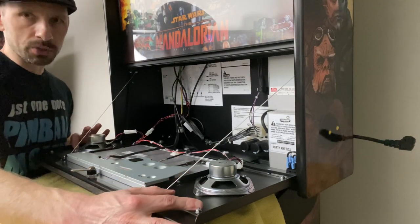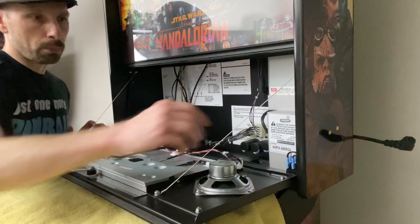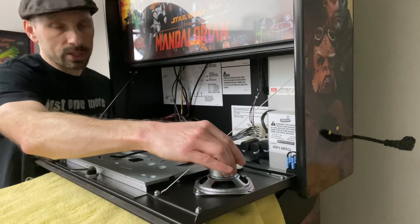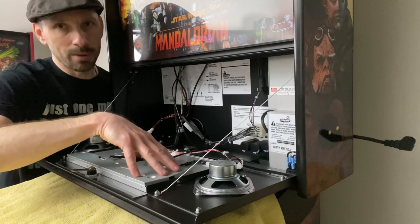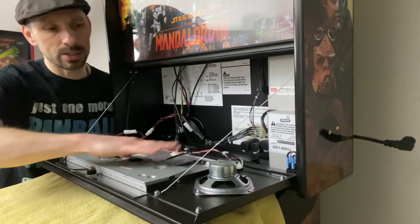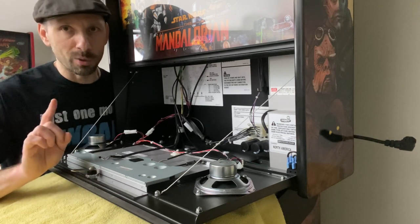This is what you'll see for the back box behind the grill, out of the box from Stern. You've got your speakers, four bolts that hold it in place, and two screws that attach to the LCD. Important thing to note — it's these side plates that support the speakers that also keep your LCD properly positioned. It is highly recommended that you only remove and replace one of these at a time; otherwise your LCD display will come loose and be a real pain to reposition.